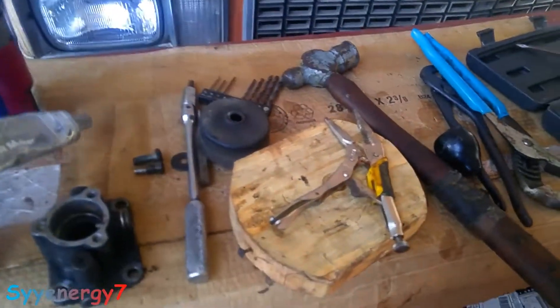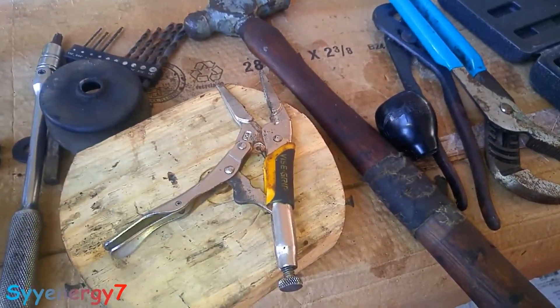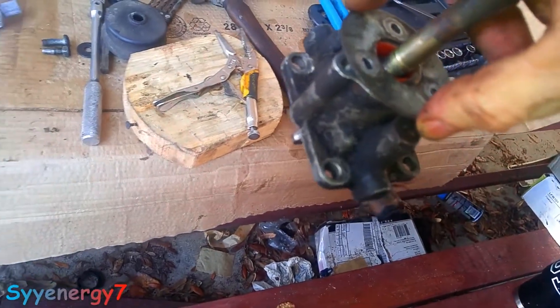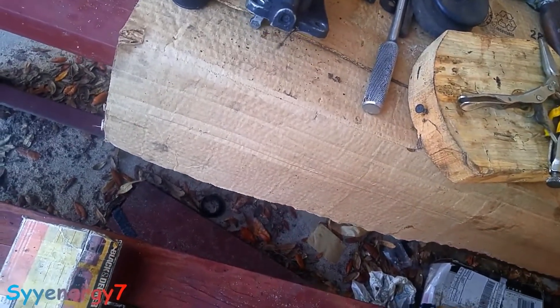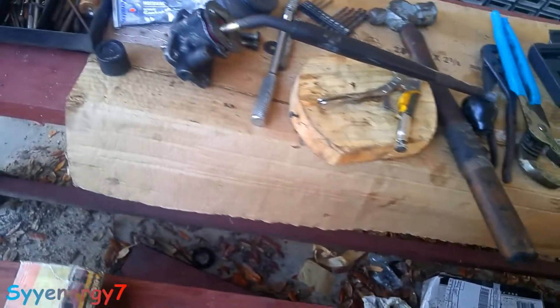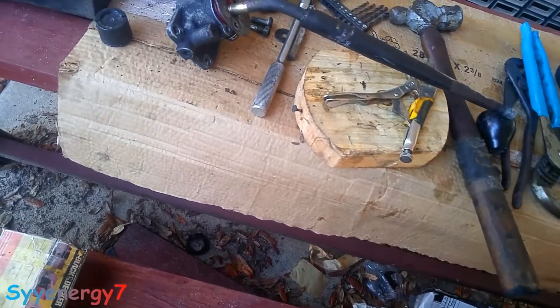Gasket maker gray. This just slides through there — I was trying to push it through where those two springs are, and this goes in. You bolt the tower back on with four 12-millimeter bolts, then put the three 10-millimeter bolts over here. That would normally be a 12-millimeter, but I've got that other bolt in there and it still works. Then this slides off to the top, and over that is a boot that protects from dust.